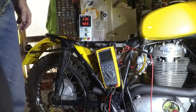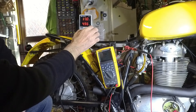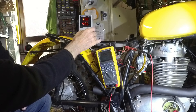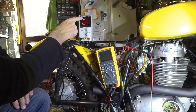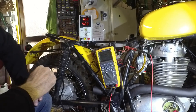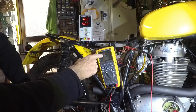Let's give it a feel. Yeah, so the Zener diode is getting warm, but it seems to be working basically. There's a lot of voltage though — this bench supply reading is way off. It's actually 15.5 and the bench supply is showing 17, so that's crazy. But 15.5 volts.